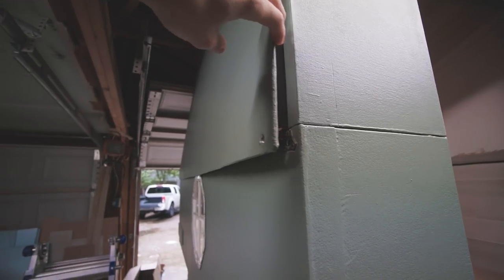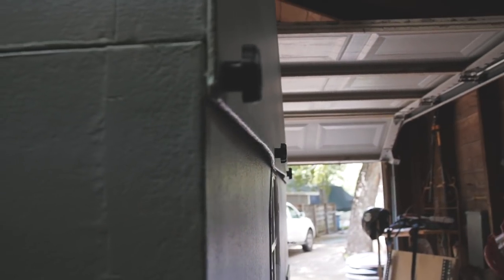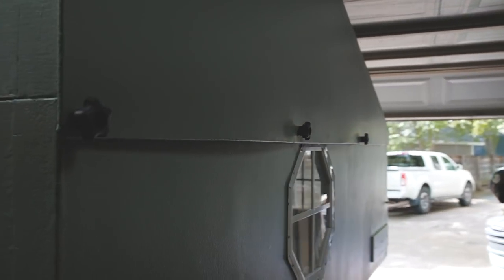This is what I thought was going to be a good idea for connecting the top walls to the lower section, but it's actually been causing me a ton of trouble — two main issues. The first is that it doesn't apply even pressure to the bottom of the wall. Since the plywood is so flexible, it pushes the wall down right where the bolt is, but in the sections between it's still bulging out. The second issue has been alignment. When I first put the threaded inserts in and drilled the holes, I didn't have the gas springs connected, and when I reattached them it shifted the whole roof forward, misaligning everything by just a little bit. I've tried adding a spacer behind the hinge and adjusting the gas spring placement, but I haven't been able to get everything to align quite right.